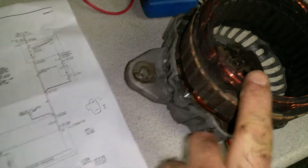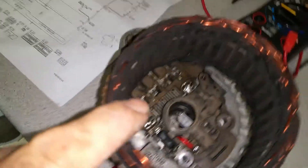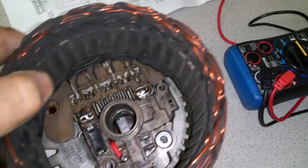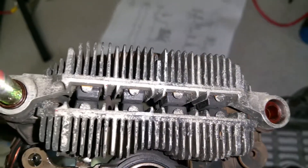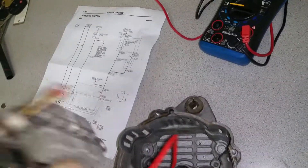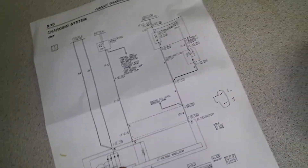So this is the schematic of this alternator. As you can see, there's the stator coil, and the rectifier which is made out of eight diodes — you will see the heat sink. I took it apart, and you can see the rectifier with the black little rectangular-shaped diodes. One of the heat sinks is connected to ground, and one is connected to the big positive bolt that connects straight to the battery.